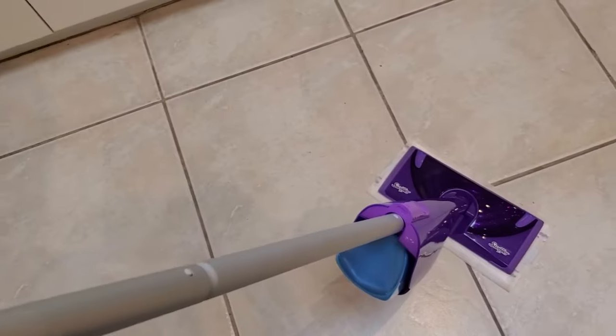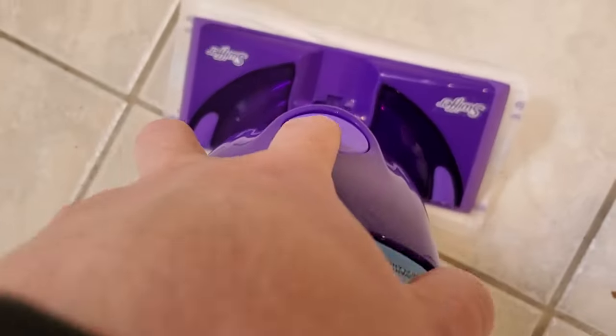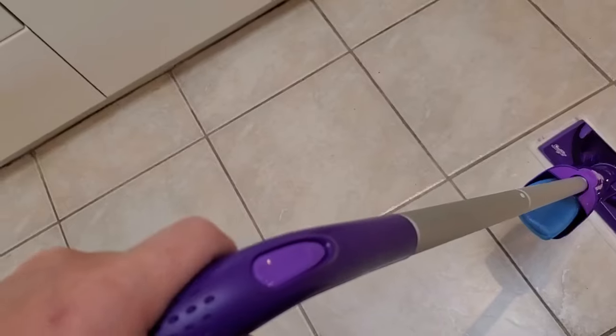The first reason is that you may have used up all of your cleaning solution. You can flip it over, press the eject button to get the cleaning solution bottle out, give it a shake, look at it under the light, and that'll give you a sense for how much you've got. If it's empty then you probably need to replace it, and that's probably why it's not spraying.